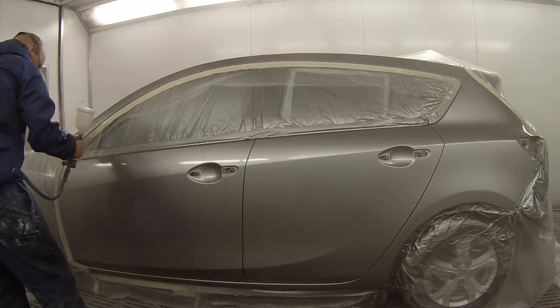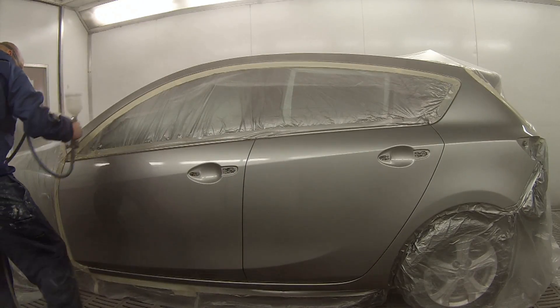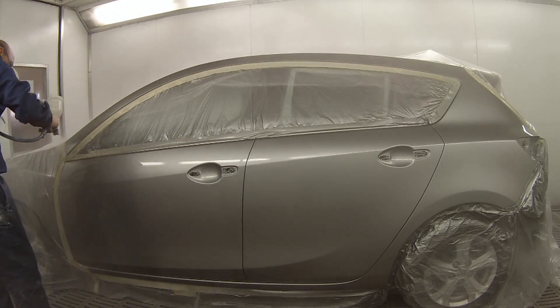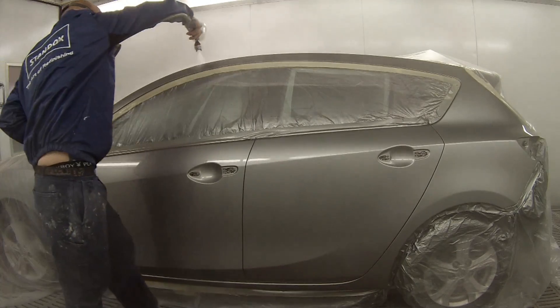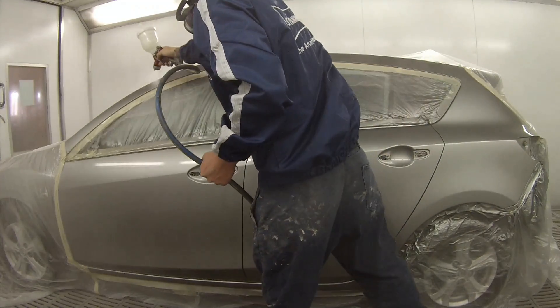For this job as far as clear goes, I ended up using 600 mils for the whole job — 300 mils per coat, which isn't excessive. That covers a full rear bumper bar, which usually takes a bit of paint anyway, and three panels.